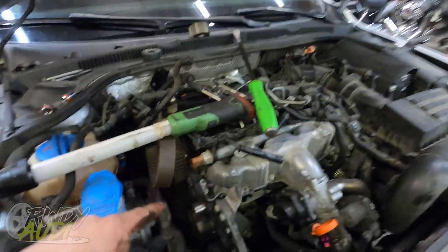That brings up the question — are the injectors clogged? Is that where all the metal went? It's starting to look like he might need fuel injectors. I'm not going to guarantee it yet. We're going to put a high pressure pump on there first and see what we get. If there's damage already in the injectors, putting a pump on isn't necessarily going to do more damage to them, since the pump is self-contained away from the injector side. But I'm holding the reservation we might need injectors.